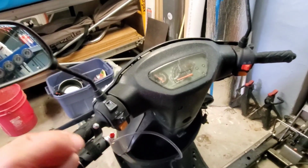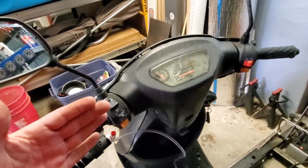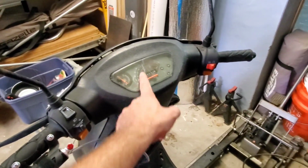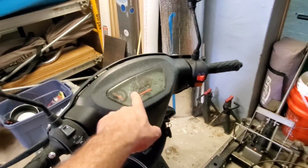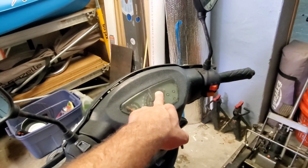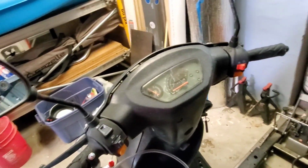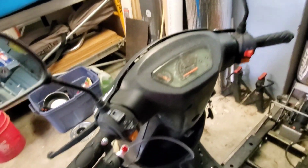What you want to do is wait until you go, and then the engine will die down a little bit. And then when you hear the engine start building RPM again, when you get to that point, that's when you spray, right? And then you watch your speed. So we have to top off the scooter first and see where it maxes out at. And then we spray when we start reaching the power band of the bike. And then you let off before you reach the top end of the engine, because there's still going to be like a half second to a second burst beyond that, where it's going to keep the engine going well past what its design spec ratio was supposed to be. So I'm just saying, we'll probably get up into the higher marks of the engine.